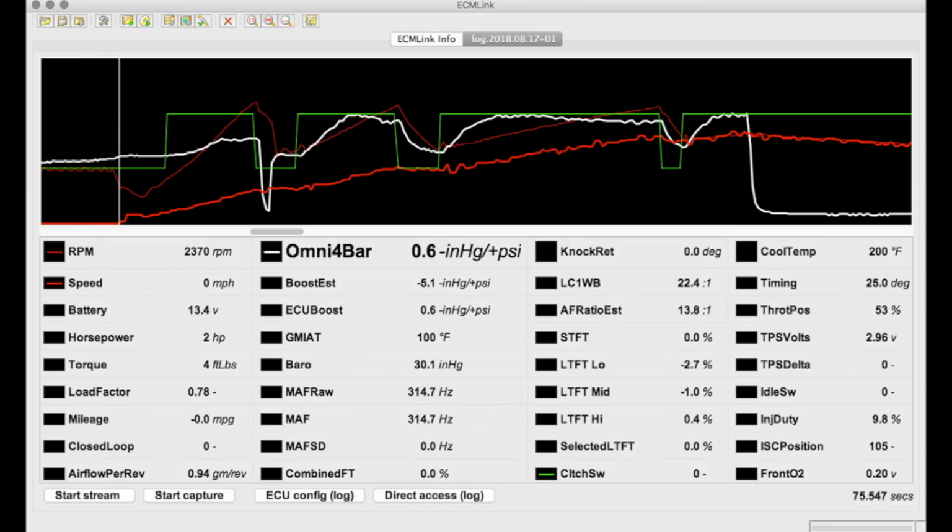You can see right here in the log where my mile per hour hops up real fast. That's wheel spin. But then my speed signal flatlines at 11 miles per hour. From the driver's seat, it felt like the launch limiter wouldn't release and that it held me back. But the log doesn't say that at all. I believe the truth is somewhere in between because of this weird area where the speed signal flatlined and how the speed signal acts throughout the rest of the run. I think it should have registered more than 11 miles per hour when it spun, and it should have released the launch control, but it flatlined at 11 miles per hour for over 0.4 of a second.